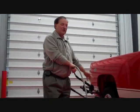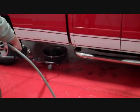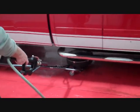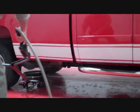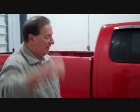If it's not bad, you can go right to the salt neutralizer. You flip the lever open, it dumps the pressure and activates that valve. You'll be able to tell when it comes out — there it is right here. All you do is coat the bottom of the vehicle, whether it be a pickup truck, fire truck, school bus, whatever it is. Just coat it — you don't sit there and wash with it because you're going to waste product. In the school bus industry, it takes about three quarters of a gallon to coat the underneath of a school bus. Once you put it on, you don't have to take it back off.